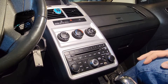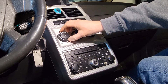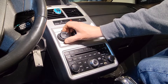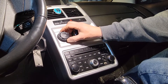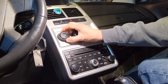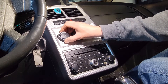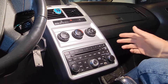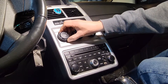I've got a 2010 Dodge Journey here and the fan is not working on all of the positions. It seems like it only works on one and three, not two and four. I hear a little bit of noise in there and I find it pretty odd that it would be the blower motor because it's not working on high at all.